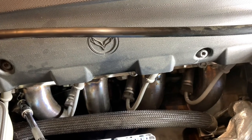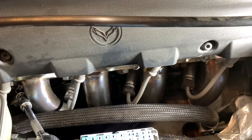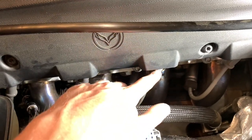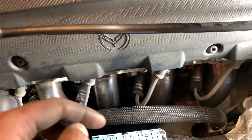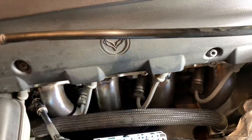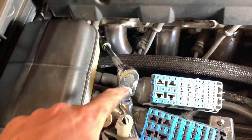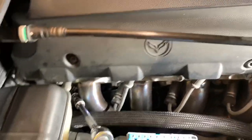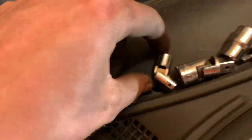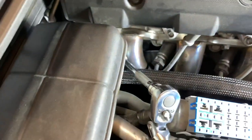Try not to crush the metal part and damage the plastic underneath. I've just been leaving these in — pulling them out, taking out the old spark plug, putting the new spark plug back in, and pushing them back on. You just want to grab a ratchet — an angle head helps. I've got some swivel joints, which really help. Some of them you might not be able to get without swivel joints.